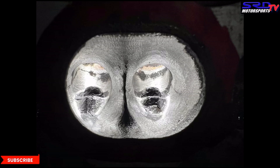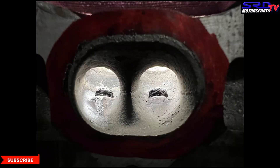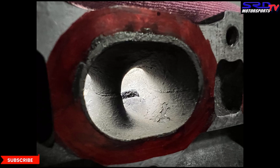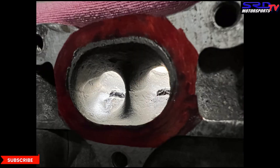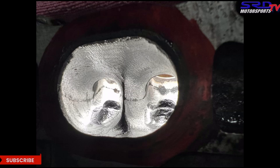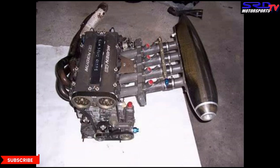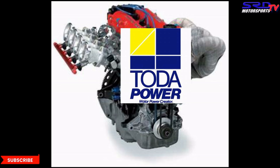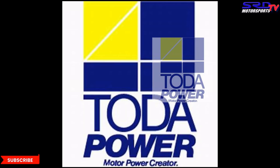Here's the carbide finish — carbide shaped. Now let's go to the before and after. You can see the stock ports, and this is the shape it got. We didn't really hog the ports out — you can still see the casting marks. It's not totally hogged out. We're just getting the shape that we want and need to increase efficiency. Did you know that Mugen used the B20A non-VTEC to power its Formula 3 racers? That's road racing or circuit racing. Even Toda did the same thing for their Formula 3 program. That's like 10 laps on a Friday practice, 15 on qualifying, and 40 for the race. That's efficient.